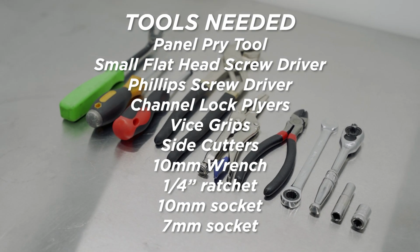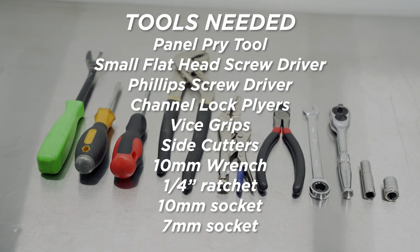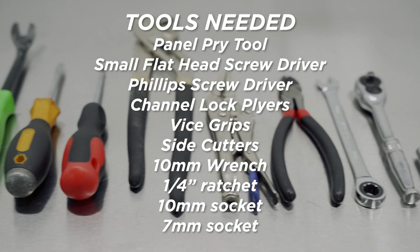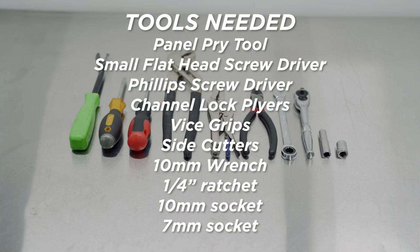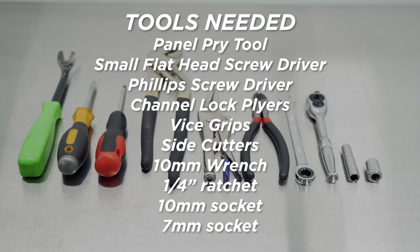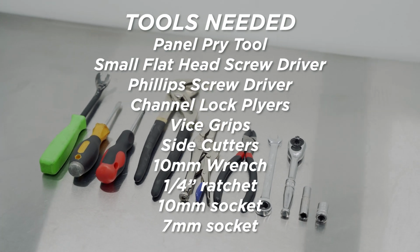We're going to need a panel pry tool, a smaller flathead screwdriver, a Phillips screwdriver, a pair of channel lock pliers, a pair of needle nose vice grips or something to clamp a hose with. Need a pair of side cutters, a 10mm wrench, 1/4 inch ratchet, a 10mm socket, and a 7mm socket.